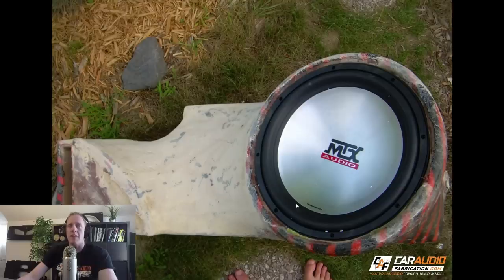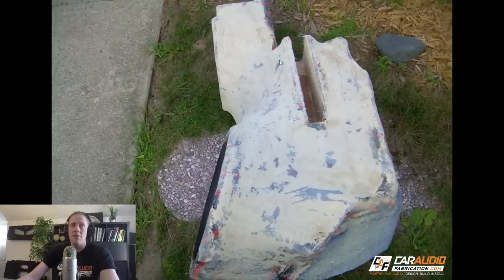At this point I started adding some body filler - I just set the sub in there to get an idea of what it would look like. There's a low spot right here where sanding didn't touch that area. I eventually applied body filler to the whole surface and block sanded it to get it nice and flat. Also, based on the color of this body filler, it probably wasn't a very good one. In the future I splurged and got nice body filler - the price difference is really only about $10-$15. I now use Rage Gold and I will never go back; it sands like butter.